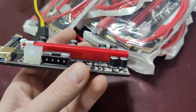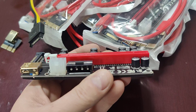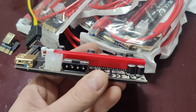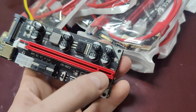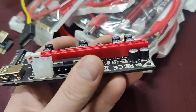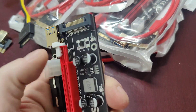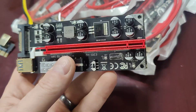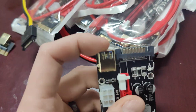Sometimes the GPU might slide out a little bit. Imagine the GPU is sitting inside the riser, and the riser tilts slightly — either sticking down or coming off on the back side of the GPU. Now the connections on that corner are not fully connected to the GPU, and that could cause issues. We use the lock, but it doesn't mean it won't still have problems. That's one thing we look at.